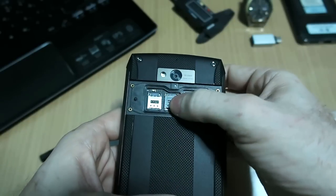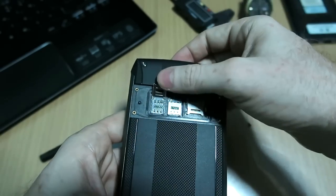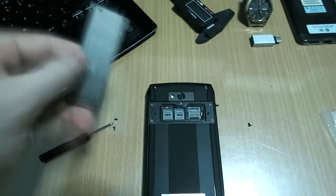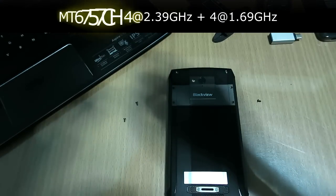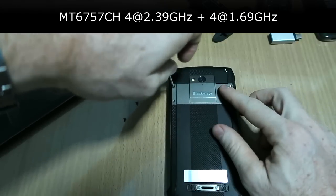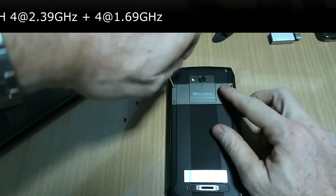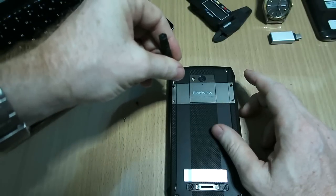It's already unlocked — just press that down and lock it. When you put these screws back in, you don't want to tighten them too tight. You'll actually feel a point where it hits an almost lock spot. Turn it very easily and then it hits a spot where you have to put significantly more pressure to tighten it any further.